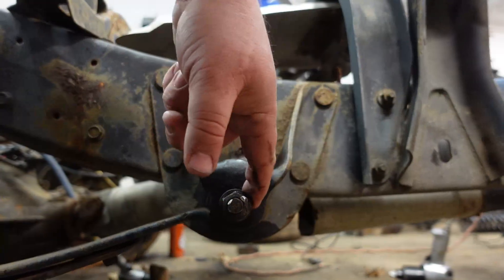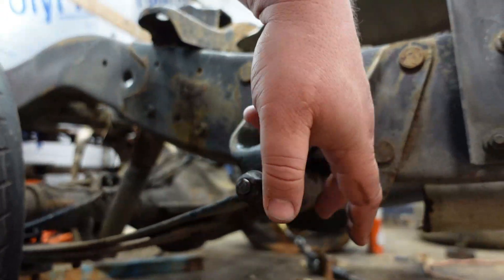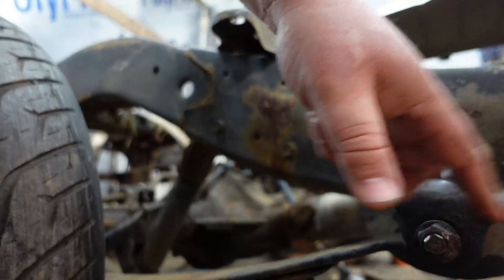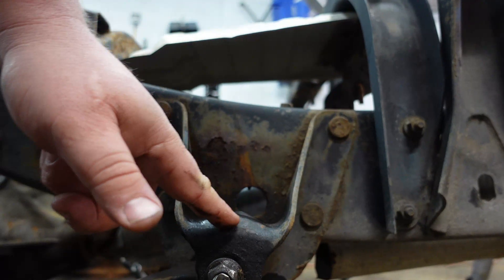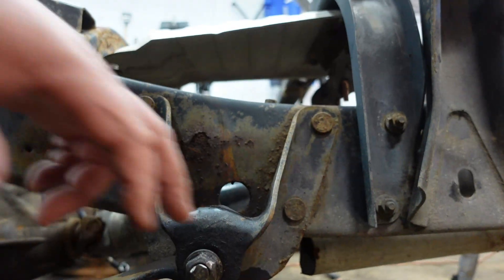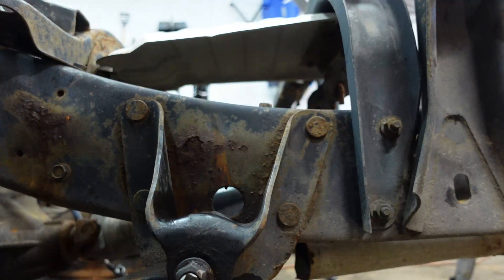For the example I'm going to do right here, I'm going to try and get that out. On the back side, as you can see, is where my spring hanger is — or my bushing is. This nut and this bolt on the other side are both hung in that bushing. I'm going to cut that off right here to expose it, then I'll try and use my air hammer and do a few other things to try and free it up and push that bolt out the back side.